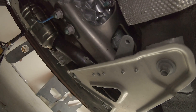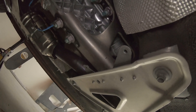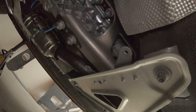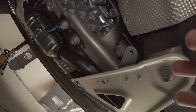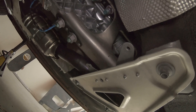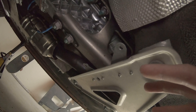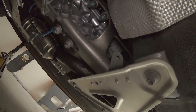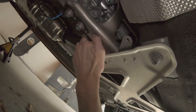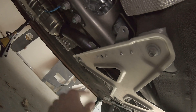It's also possible that if you wrecked your Miata, the collision might have knocked this out of alignment. I haven't wrecked my car, but I just wanted to do a sanity check to make sure that the power plant frame was aligned. I found the specifications for the alignment in a workshop manual online — I'll link that in the description below. The process for checking the alignment is super simple: we need to measure the distance between the bottom edge of the power plant frame and the top edge of this X-shaped cross member.